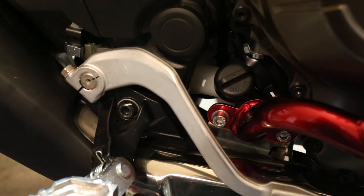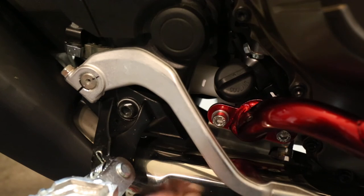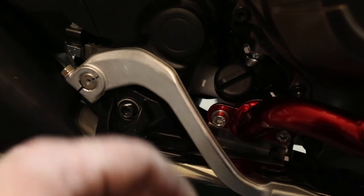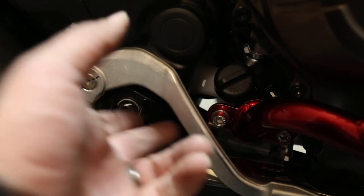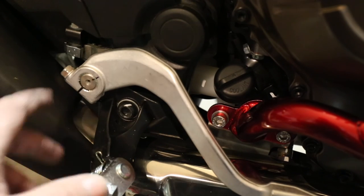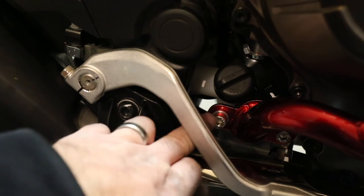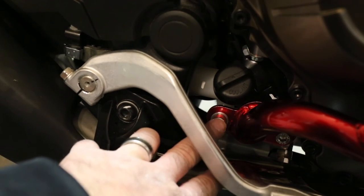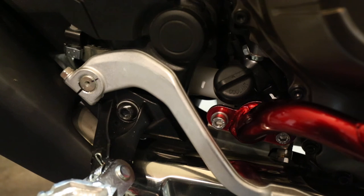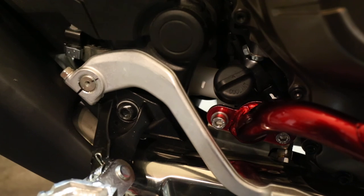I told you I wouldn't bring you over to the other side unless there was something a little different. You have to install a bracket that goes down here — you'll see these two bolts in between your muffler and the frame. That bracket holding the lower crash bar up here is actually a little tight. I also doubled up the washers on this side because it will actually hit the little plastic coolant sleeve back there. I used the Sharpie to mark the brake lever position because getting to that bolt right behind the brake is almost impossible — so just pull it off, mark it, and put it back in the exact same spot.